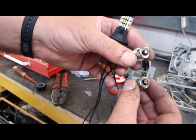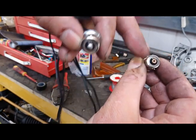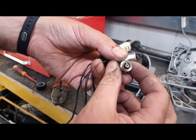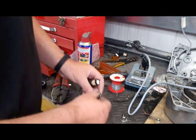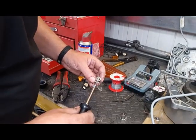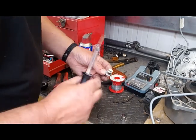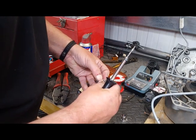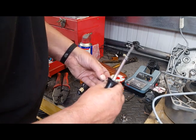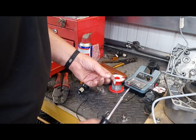Now, switchbacks come with a spare base — it might look like a spare base initially, but if you look, the pins on this one are offset and on this one they're in line. On the ST1100, the pins for the indicator are in line, so we need to change this base for this base. It's really, really easy as long as you've got a soldering iron. We just sweat that solder off there first and then the centre wire will pull straight out — just like that. Then you'll notice there are two little tags around the outside to solder, so just slide your nail into there and touch the soldering iron onto it and it falls off like that. Really, really easy.